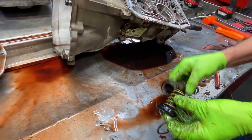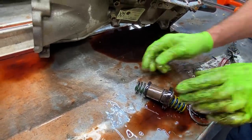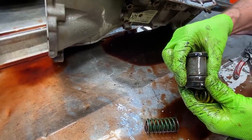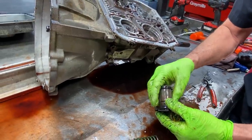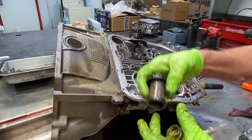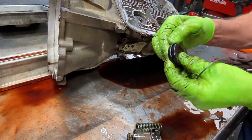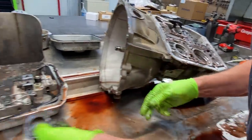Your shift kit is going to come with different springs and a spacer for this. You want to get in here and feel this — see if it's going to break off just like the other ones. This cover and piston were just solid and brittle, there was no saving it. Even this one here — you can feel a little drag, it's still got some tension and feels a little soft. But it's still not worth putting back in there. This cover gets hard and starts leaking around the snap ring and everything, then it doesn't work and causes major issues.